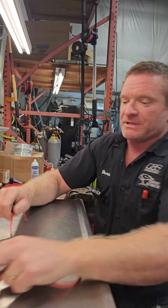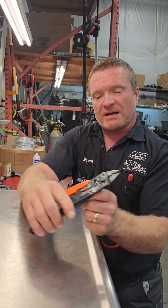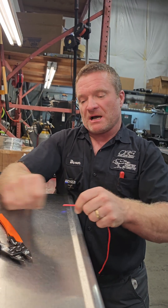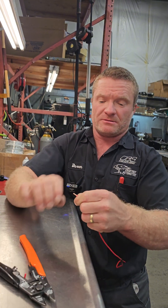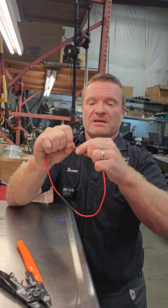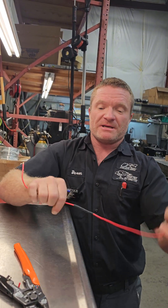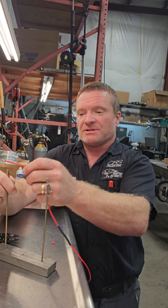All right, so the process, people, is really simple. I'm going to strip these guys back using the proper wire size on the stripper, give it a little twist. Same thing with this guy. Real quick though - did you know you can just solder these together without having a butt connector? The reason we bring that up is because some people will just splice these two wires together, intertwine them, twist them, solder them, put some shrink tubing on it. That's perfectly fine. The reason we're using a soldered butt connector is because sometimes it's a real pain to do that, and we like to make it so we can at least get the job done properly.